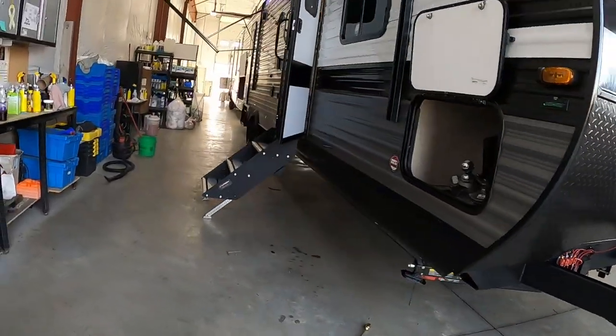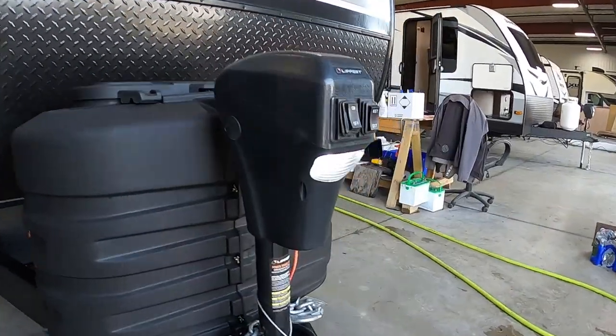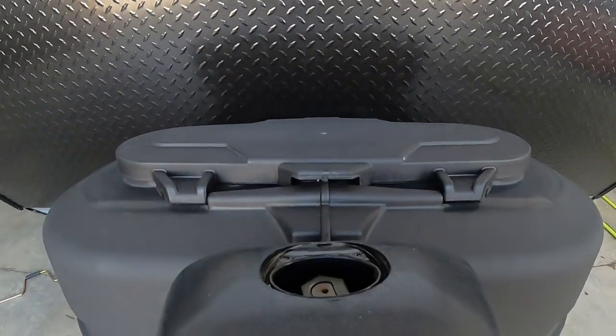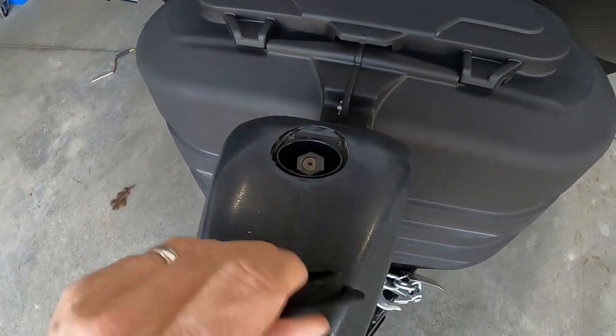Your door is close to the middle, but get a level on there to get this up and down. Should you lose power, under this rubber stopper right here is your hand crank for your stabilizing jacks — that'll get this up and down manually.